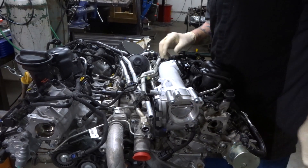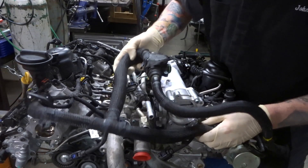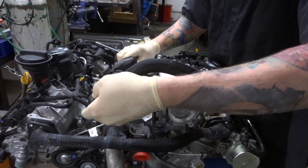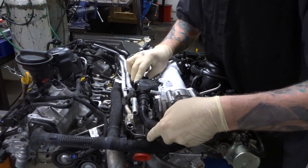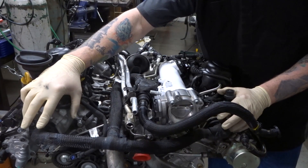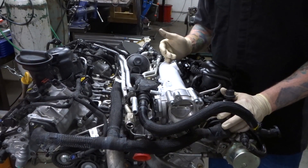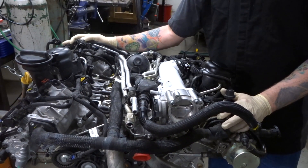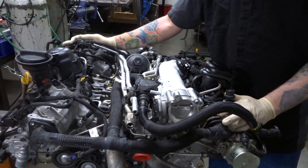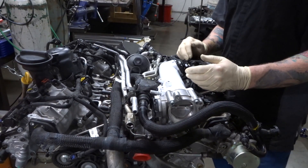So let's go over this again. The PCV system goes to each cylinder head and goes into this manifold only — this manifold shares none of the crankcase breathing system with the other side of the engine. That's a problem. You're going to have one side of your engine gunked up; the other side is going to have no gunk buildup. For maintenance reasons it's actually a brilliant idea, but for performance — left-right cylinder balance — you're just going to have one side of your engine constantly getting crankcase blow-by and the other side not getting any crankcase blow-by.